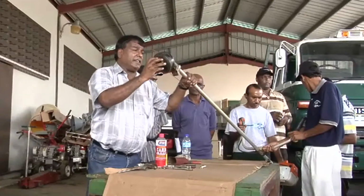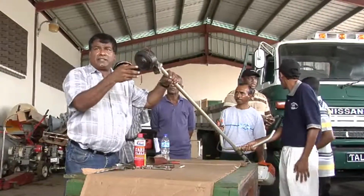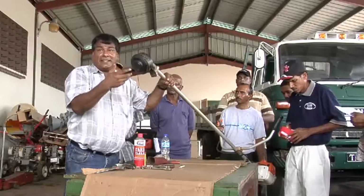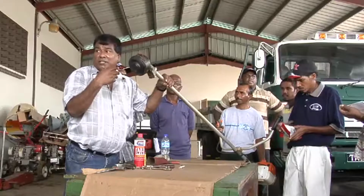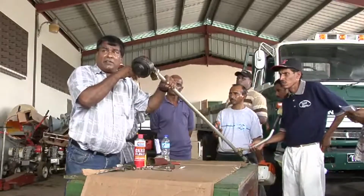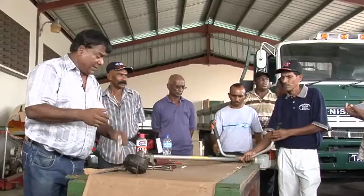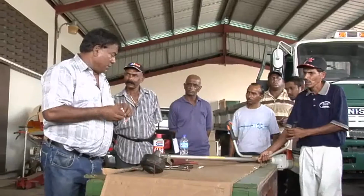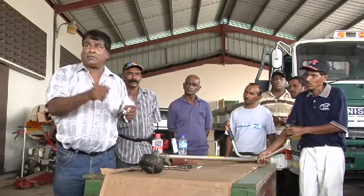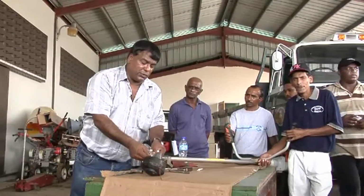After removing the grease plug, you want to examine this head to see if there's evidence of grease. By peeping through the hole, you can see grease, or in a worst case scenario, you will see shiny gears. That means that machine was not serviced properly. If you have some evidence of grease, you want to ensure that there is sufficient grease in the head. In this model, the manufacturer sells a grease in a tube with a corresponding threading, where you thread into the head and you squirt.